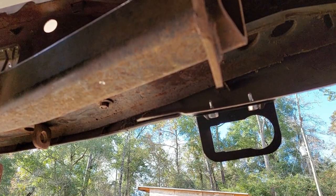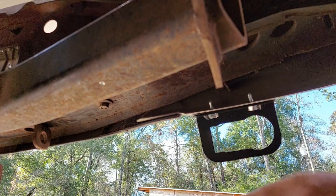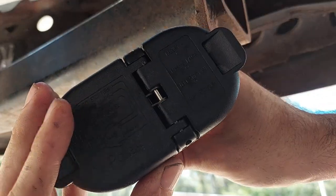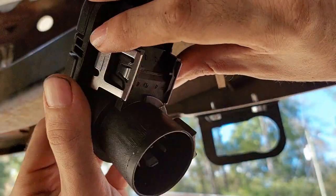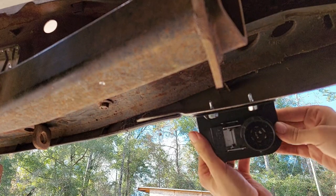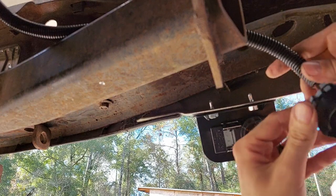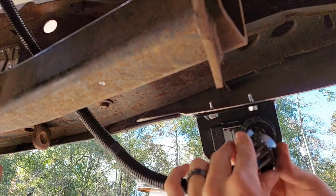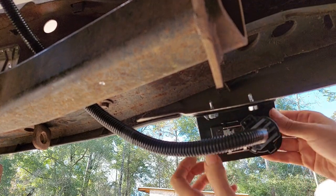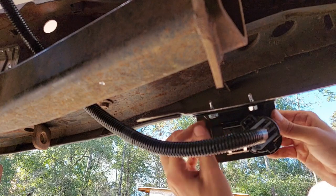You're going to need to use an impact driver to get that in even with the thinner bumper metal — I tried going into the hitch but that steel is just too thick. The connector itself is locked in with the clips you see here and here, so make sure you are right-side up and then just feed it in from the front — it locks in. Then take the connector and bring it over and plug it in, like so.